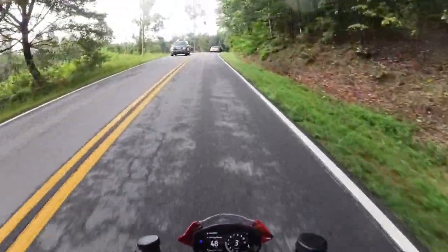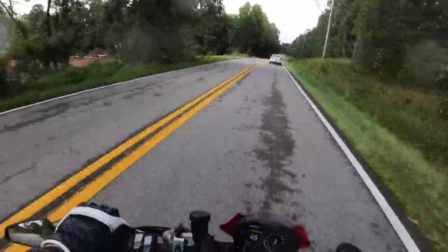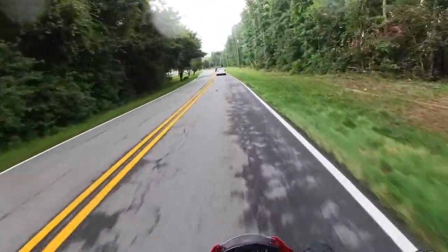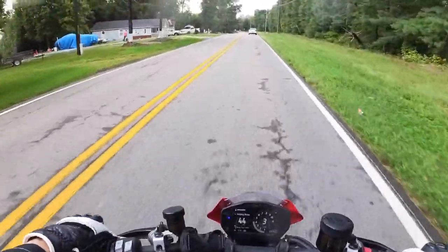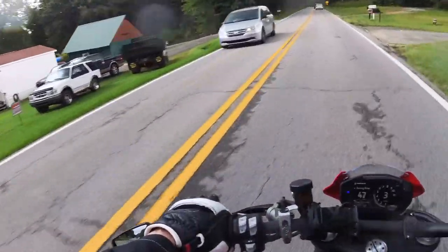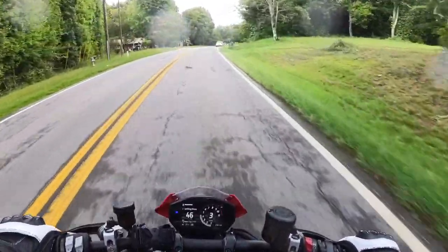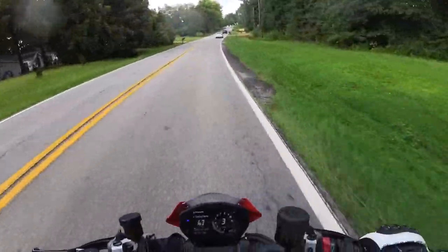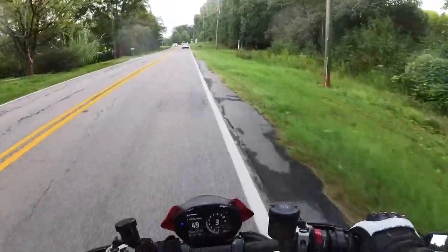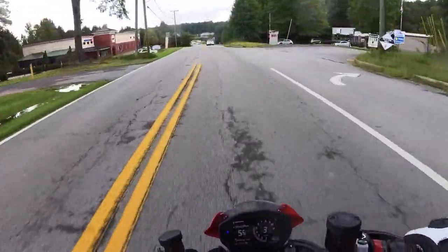You're not going to really lose top speed, and that's the thing. A lot of bikes - look at my ZX-14 - it's geared to do 208 out of the box, but that bike is not going to do 208 miles an hour. So gearing a bike down so you actually can hit your theoretical top speed - it's a balancing act. You don't want to go geared too low where it's really buzzy and frantic all the time at highway speeds, but you also don't need it geared to do 20-30 miles an hour more than you're ever going to go. I'm going to look at the gearing charts - I have a feeling we can gear this bike down a little bit and make it nicer.